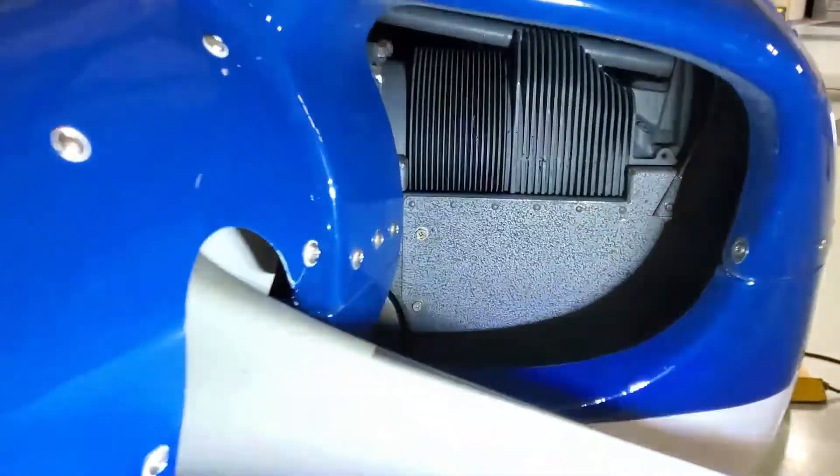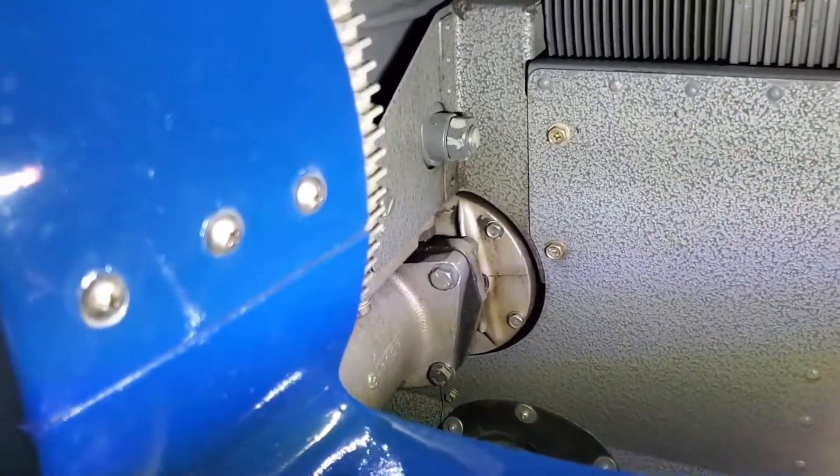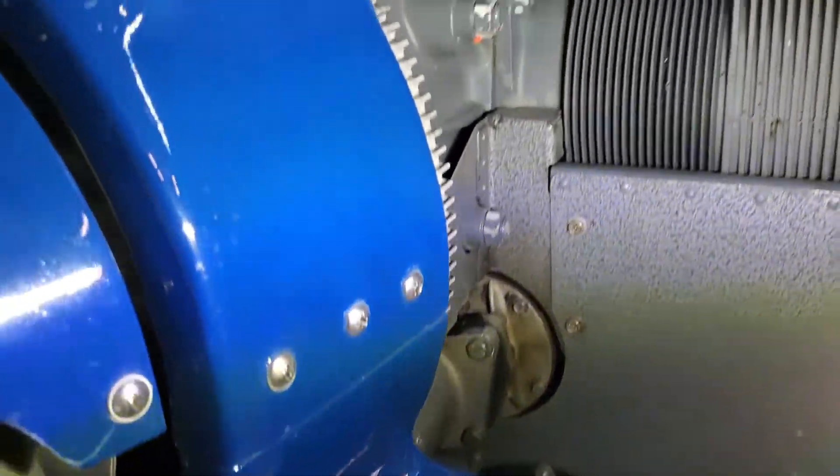Pre-flighting — always have a good light. I can check the brake pads, the brake area for any leakage, and then looking in the cowling and making sure there's no birds or anything living in the engine compartment. You're going to see just great with these. It is so bright and they last for hours.